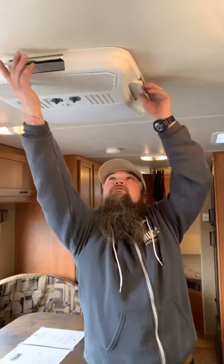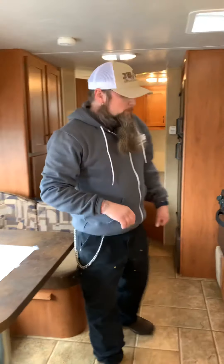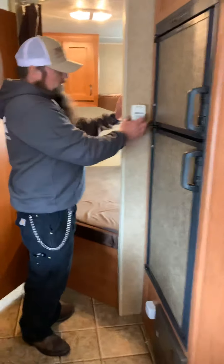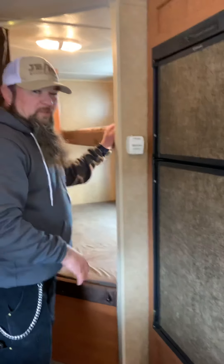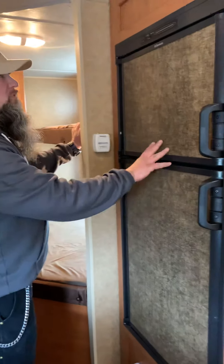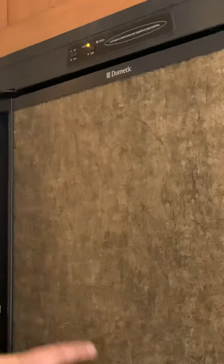The air conditioner is here — all controls are on the AC unit. You have options for AC or just the fan running, and go to off to turn it off. This dial is your temperature control. There's a quick dump option so air dumps straight down more rapidly, or you can manipulate the vents to direct air where you want it. The filter pops down to clean, or you can hit it with a vacuum on the side — it's a thin mesh filter, not one of the thicker foam ones.